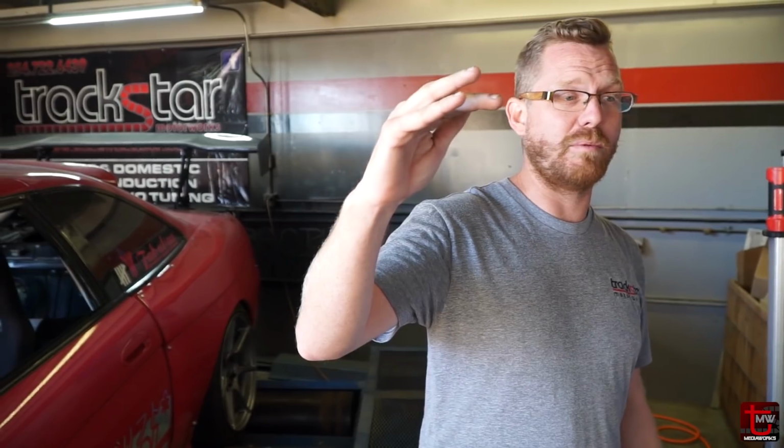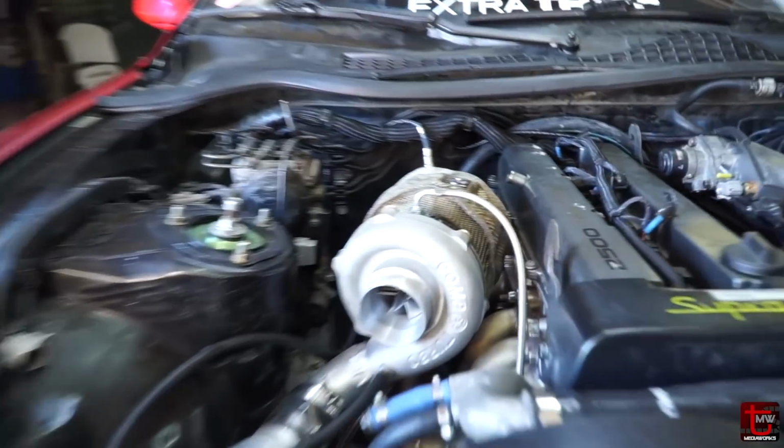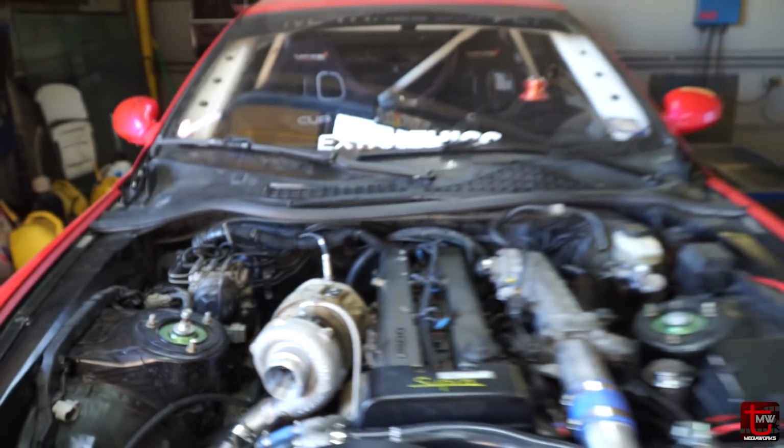You don't want to pick an 800 horsepower turbo if you're going to be operating down at 400 horsepower. Yep. You also don't want to have an 800 horsepower turbo if you're going to try to operate at 800 horsepower. You need to find a nice happy medium. You need some kind of headroom, but you don't want to be doubled, because then you're leaving a lot of response and area under the curve on the table. Yep. So that just shows really good turbo choice, comp turbo. Absolutely. It's a really good setup.